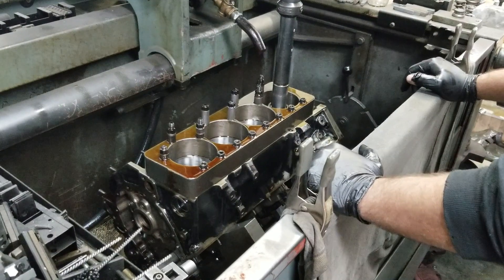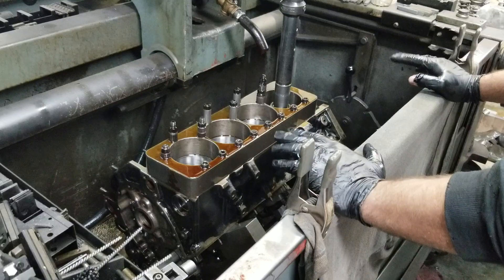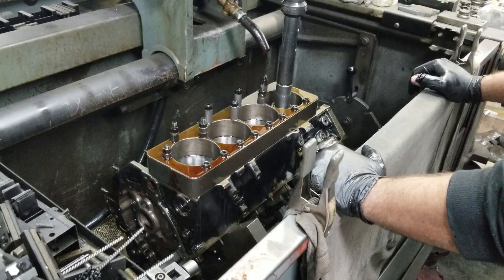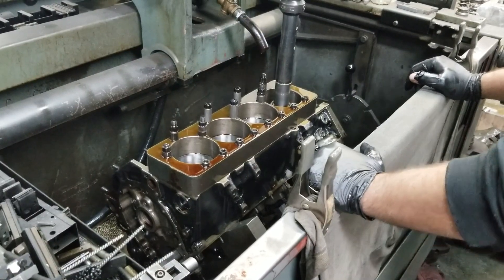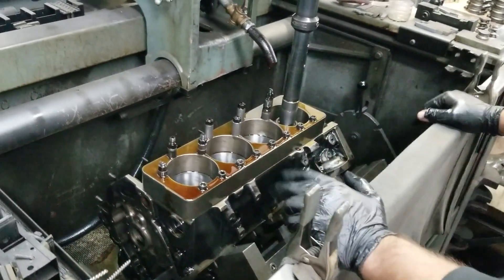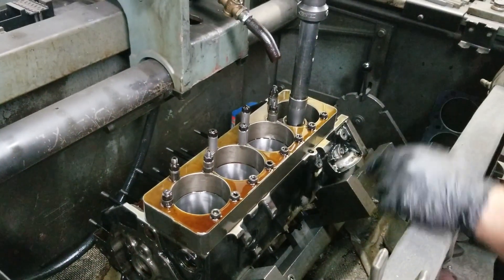So I reset the mic up to 4.075, and we're all clean and all straight now. I'm just taking a final finish on this thing — usually three or four strokes with the 818 just to break the peaks off. That's what I'm doing right now. We're on our last cylinder.